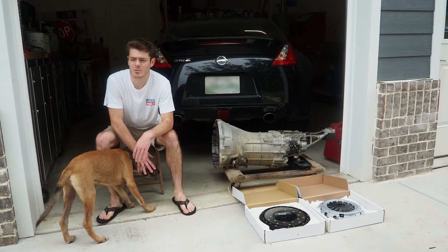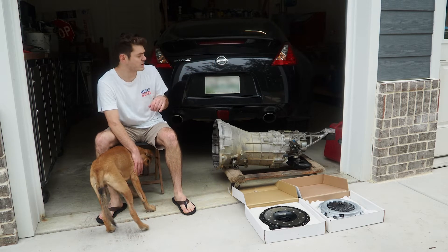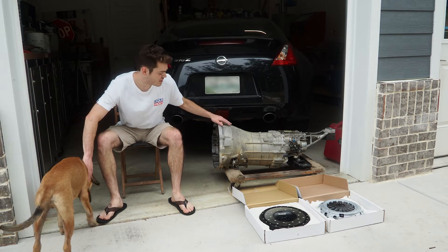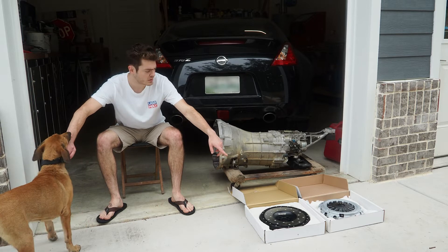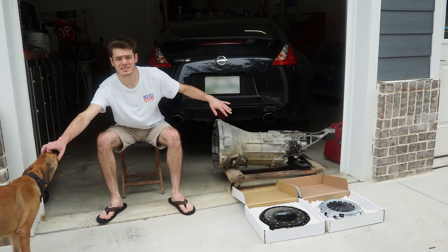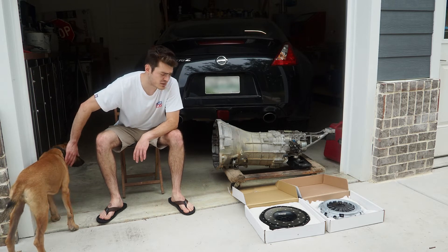By the time I'm done, it will probably start warming up and be warm enough to actually start riding again. The next video will be on this — my daily driver, a 2014 370Z 6-speed manual touring package. About a week ago, my clutch slave cylinder went out and then my clutch got destroyed because of it. So I took the old 6-speed out and we're going to be doing some upgrades — a Jim Wolf Technology lightweight flywheel, pressure plate, and clutch. The next video will be on installing the Z-Speed slave cylinder relocation kit so that if the slave cylinder goes out again, I don't have to drop the whole transmission, because that kit moves the slave cylinder to the outside of the transmission.